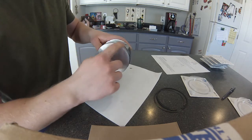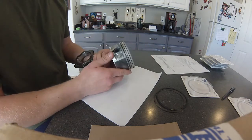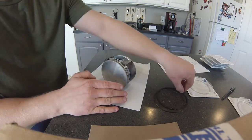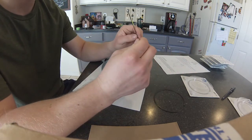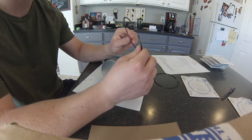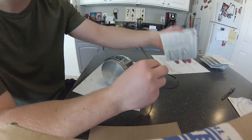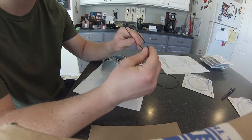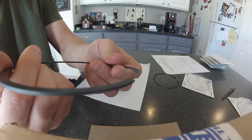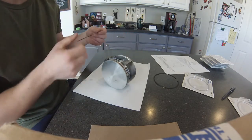Try not to scrape the crown when you pull it down — make sure you're pulling it away. So those are staggered correctly. We have our second compression ring, which also helps with oil by scraping it down. This one has a little bit of a lip on it, and you want to make sure that lip is facing down towards the oil pan. That little lip needs to face down — that's what helps scrape the oil off of the cylinder walls.